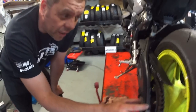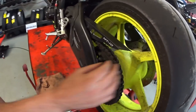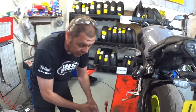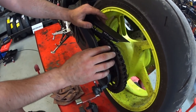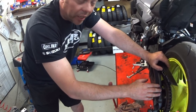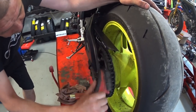This chain doesn't look very healthy, does it? But it's not worn out — it's not had its day. It's still pretty tight on the sprocket. It's covered in grime, grit, and all the other muck — a little bit of surface rust. It's not the worst we'd ever see but it's not the best. What you've got here is basically an amalgamation of grease, oil, and grit, which acts like grinding paste and will wear the chain and sprocket prematurely.